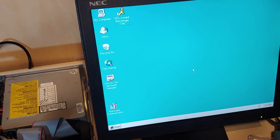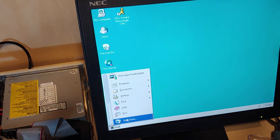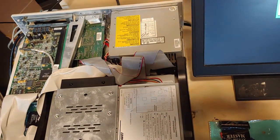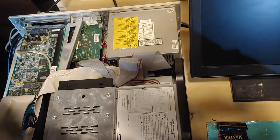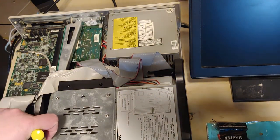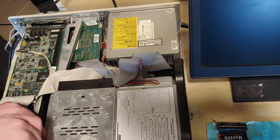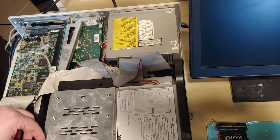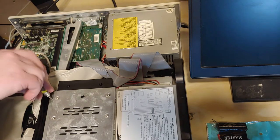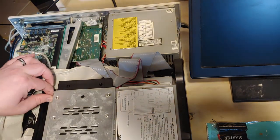now that we got the CD-ROM part resolved, and the disk is out, the next thing I want to do is do the simple thing and put this IDE cable in. Because the other one that was in there was throwing, every once in a while, a 1782 error, and that was preventing the computer from booting. Should this cable work? I don't see any reason why it wouldn't. This'll help us a little bit in the mess we call cable management in this tower.